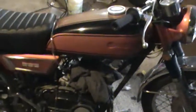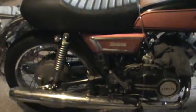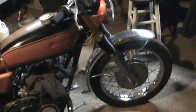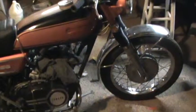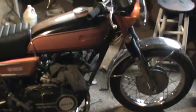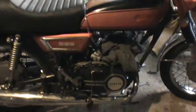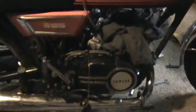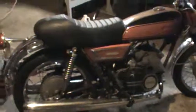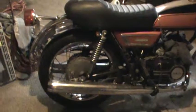I pulled the carbs, reset everything, synced them back up, kicked it once or twice, and it fired right back up — nice and even, as nice as any RD I've ever had that was properly tuned. Really fast bike. I rode it around even with loose front suspension just to get a feel for the engine — it ran very powerful, could just pick the wheel right up. It's just like an RD except it has the five-speed R5 gearbox.